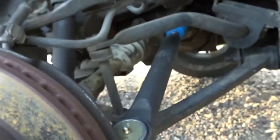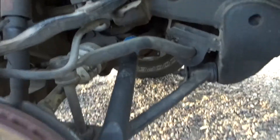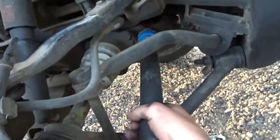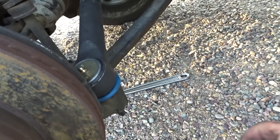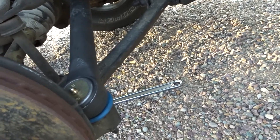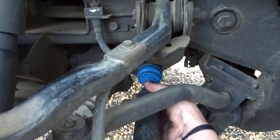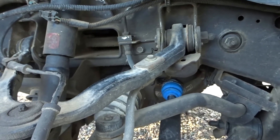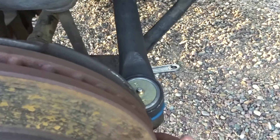That is how you do heavy-duty tie rods that are made for a Duramax to fit a GMC Sierra. Once they're tightened down — like on the other side I loosened it — there's no wiggle room in that taper. Sucks it down nice. The taper is about perfect when I was measuring it with my micrometer. It should be a good upgrade from stock and I'm excited. Next I just need to get alignment. Don't forget to tighten this bolt so things don't move — we'll tighten that now and then we should be good to go. So thanks for watching and I'll see you guys all next time.